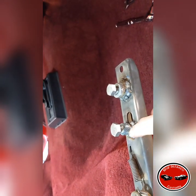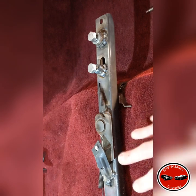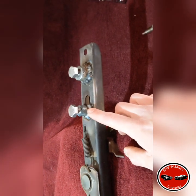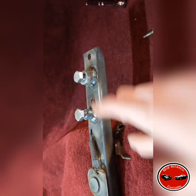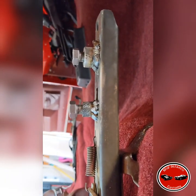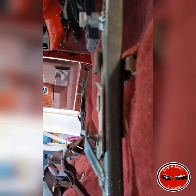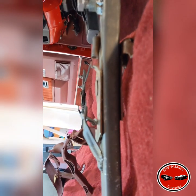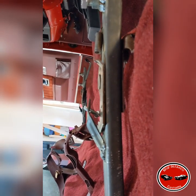I have two additional mounts welded in the front. Basically what I did is I set the forward frame in here, determined where I wanted my mounts, drilled through, and these are drilled and tapped all the way through the frame. I put some bushings here to give me clearance over top of this spring right here, so those will support the bottom of the forward seat and give me enough clearance so I can still move the seat forward and back.